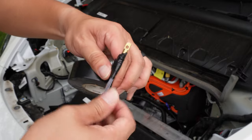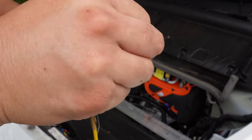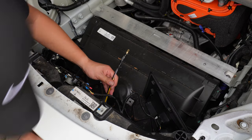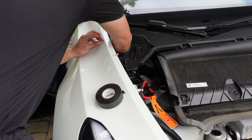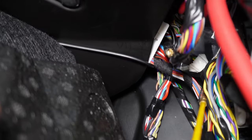We are going to take the connector of the camera wire and the fishing wire and tape them together so we can fish the cable through the bottom grill in the front bumper and then into the firewall. Now we are going to fish the wire through the grill, and in the frunk we will need to reach down and grab the wire through a small gap between the frame and the radiator. There's a big grommet where all the wires are running through. Pull the grommet out just enough so you can slide the fishing wire through the outer part of the grommet and through the firewall. Grab it and pull it through the firewall, pulling enough so you can connect it to the screen.